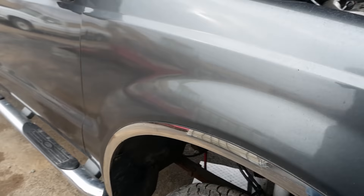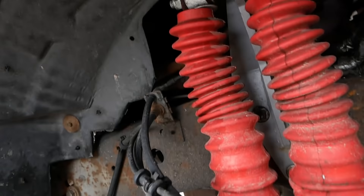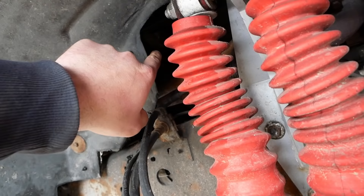It's the following morning, right around freezing. I've decided the oil leak is not coming from anywhere in the valley — I couldn't tell before because it was leaking so much coolant and the coolant was running the oil down the valley. I think there are a couple of problems: it's leaking a little from the glow plug harness — another poor design on the 6.0L Power Stroke. At each glow plug there's an O-ring that plugs into the rocker box, the aluminum gets corroded and eats up that O-ring and they leak.